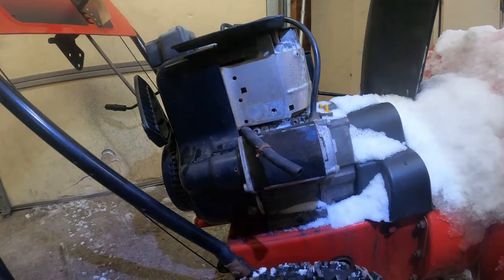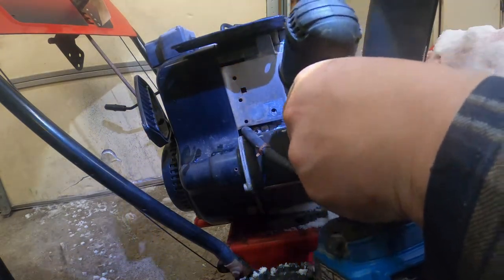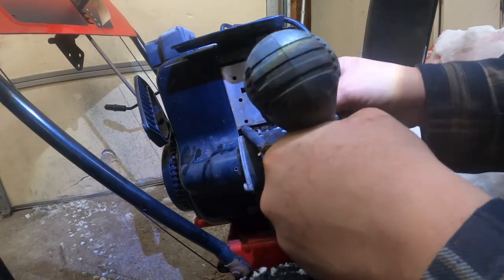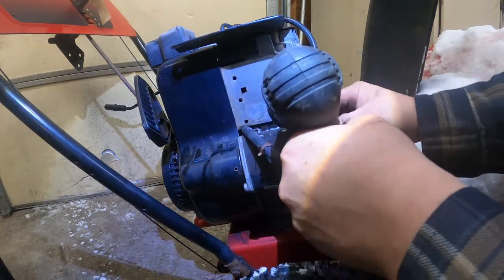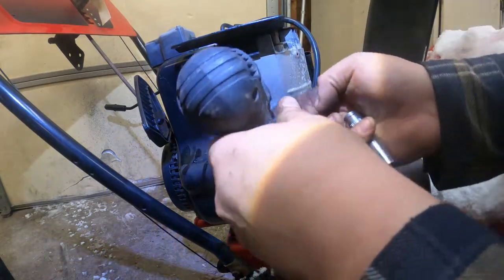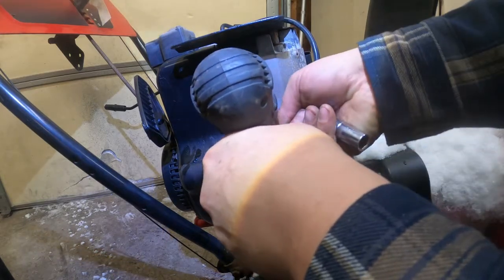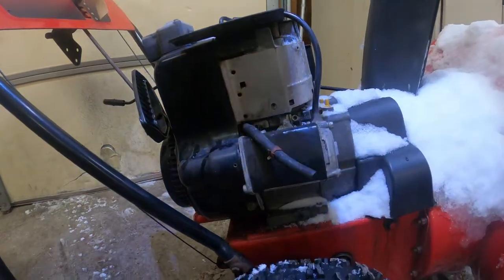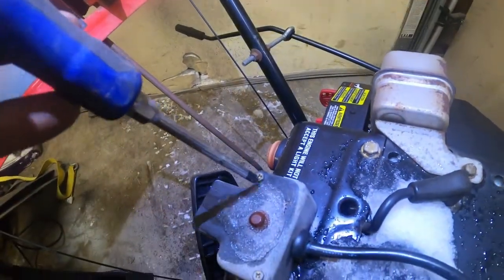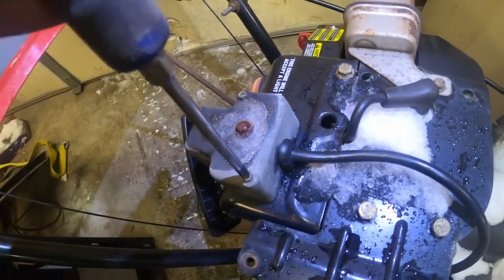So these are a T30 Torx. We're gonna loosen those up. Go ahead and take them out of there. The top ones you don't need to take all the way out. You just need to loosen, but I like to take them all the way out. All right, so now we got those out. We need to loosen up these 2 screws, one here and one here, kitty corner. Now, these are just tiny, they don't have to be super tight.